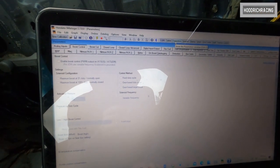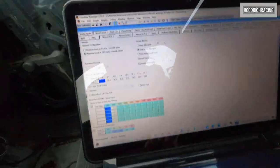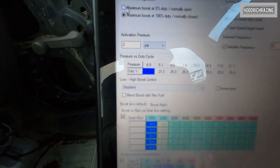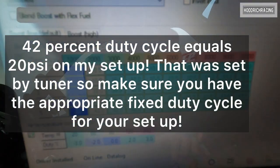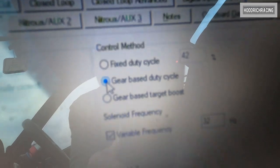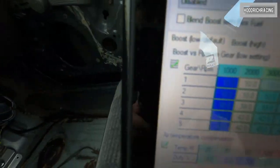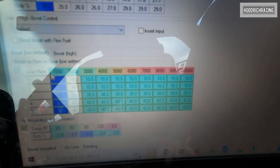Go ahead and click on your parameters tab, and we're under boost control. I just had to open up the tune that was on this ECU. Set your activation pressure to 2 PSI. Fixed duty cycle at 42% duty cycle on the boost controller — that's the max, that's 20 PSI. When you set your final boost target, you don't want to go above that because then you will boost cut. So we're going to click on the gear base duty cycle. You can see here RPM in the columns and the rows, showing first through fifth. You're going to be changing these numbers by duty cycle. There's a way to make it display in PSI, but we're just going to work with duty cycle.